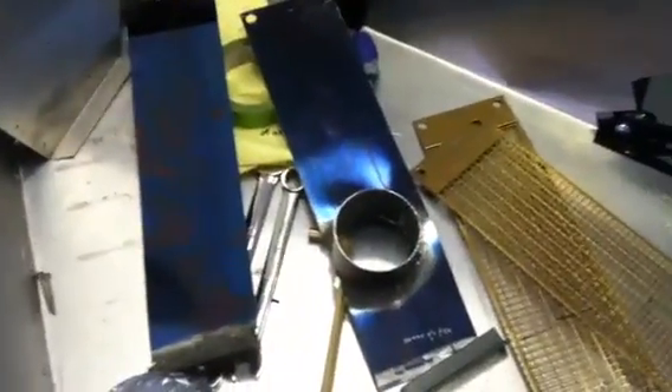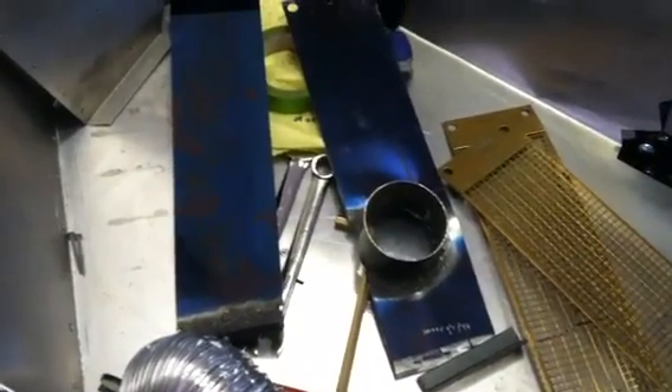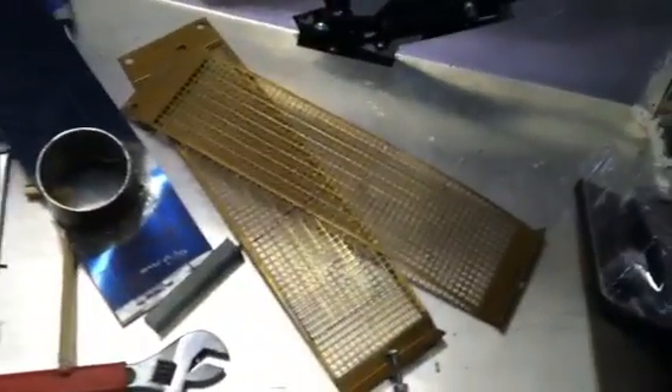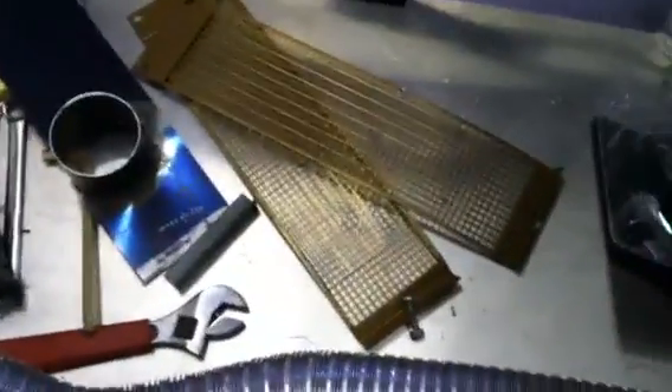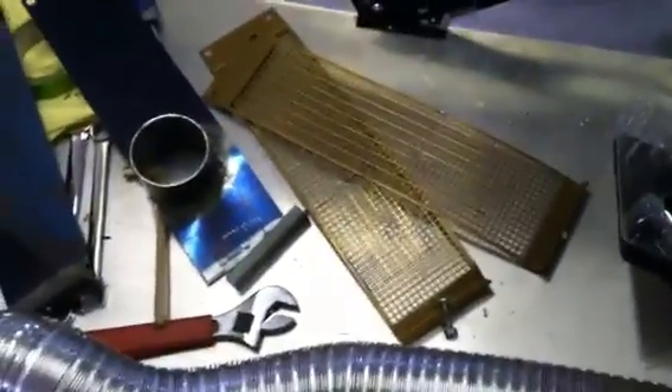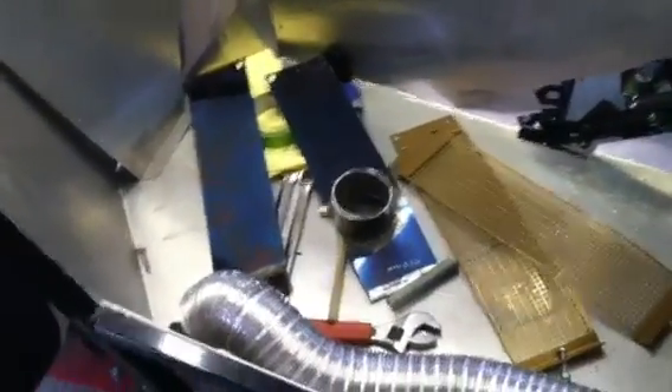For the blower, I've been working on these metal bands with tubing in them — just welded that up yesterday, cut the tubing in. These bands are going to wrap around the front of the motor where the existing bands are, which currently provide airflow for the fan inside the motor. Since the car will potentially be running at low RPM for lower speeds, that may be insufficient cooling for the motor — that's the whole purpose of the extended blower, to force-feed air into the motor to keep it cool at low speeds.